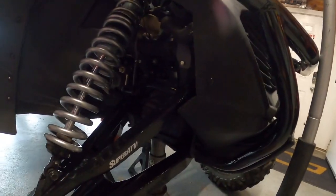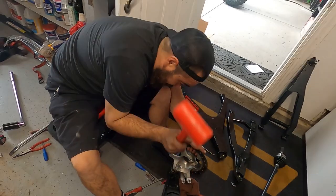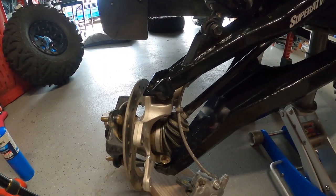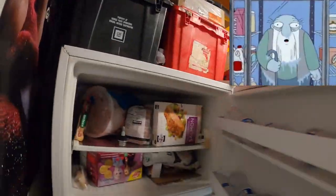You're not going to need a hydraulic press. Normally you'd take it to a shop to get the ball joint pressed in and out, which involves removing the arm — and I'm not doing that because it's a big pain. If you've ever done the arms on one of these Can-Ams, they are not easy. I'm going to get the ball joint in there without a hydraulic press, using a little bit of heat, a hammer, and — most importantly — the freezer.